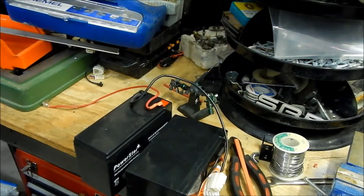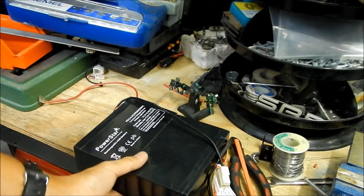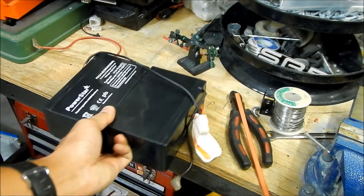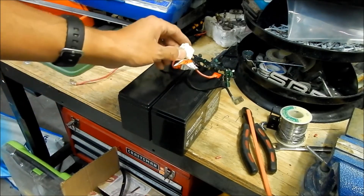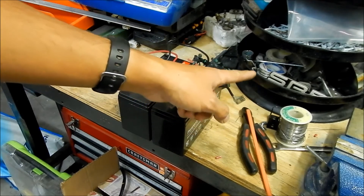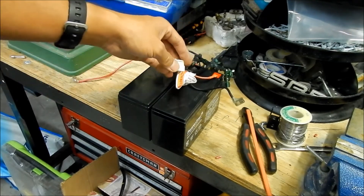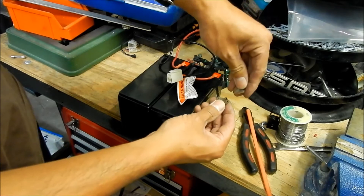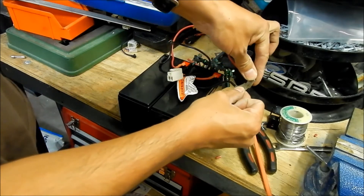That's it — our batteries are together. So if you remember correctly, it's gonna go something like that — that's the whole battery assembly, and that's how it's gonna go back in the scooter. You've got your negative going to the breaker, and then from the breaker it goes to the positive here. Then the negative goes to the controller and this positive goes to the controller. So these are basically hooked up together and it shouldn't explode — it's good to go.